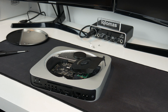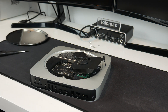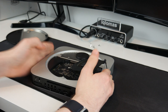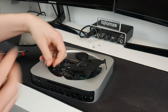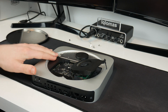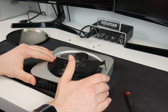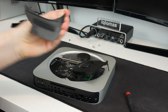I've just moved the fan off to the side — I don't want to risk breaking the connector by unplugging it, so I will leave that connected for now. The next thing we need to do is remove this plastic shroud. In here there's just one screw at the bottom — this is a T6 just like the ones on the fan — so I will unscrew that. It's got to kind of come around to the side, and it just lifts straight out.